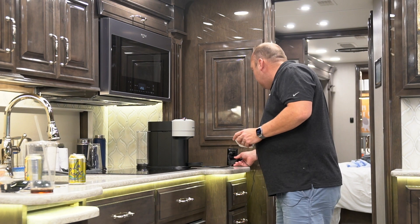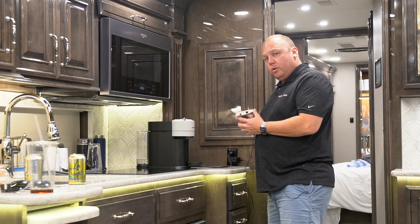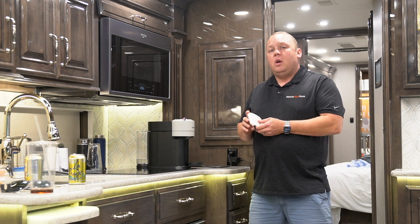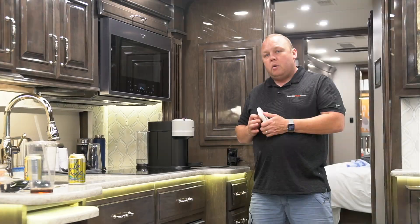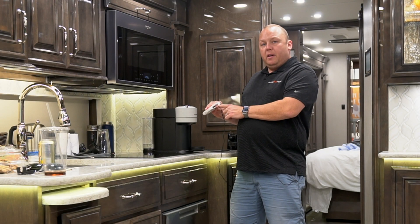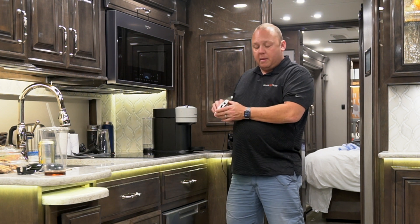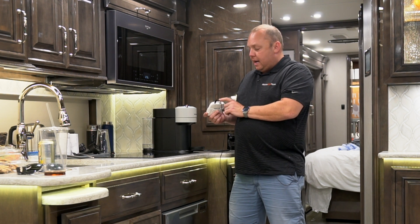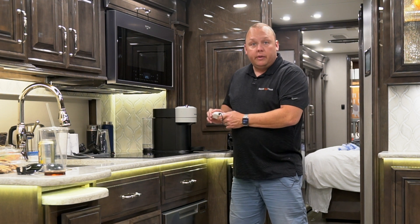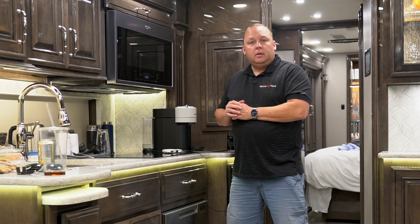We've waited our 10 minutes. Now we're ready to unplug the Ethernet cable and relocate the device. We're hopping over to the other side of the room and plugging in our access point — we've got a solid red light. Assuming we've set everything up correctly, that's going to go green, and then the Wi-Fi light, typically on the AP Mini and most of these, will begin to blink green — that's when we know we're good to go. We've got solid status green and blinking Wi-Fi. During the boot procedure the Wi-Fi may go solid green, meaning it's initializing, and then once clients connect it will start flashing rapidly, meaning data is transferring. If you've got a solid green status light and a Wi-Fi light doing its thing, you should be good to go. We're going to go back into the management console and confirm that everything's working.